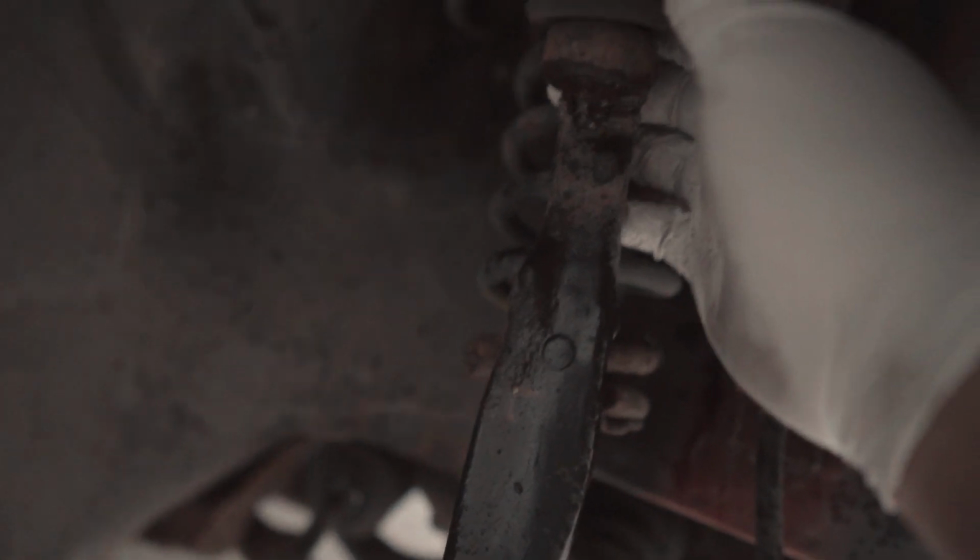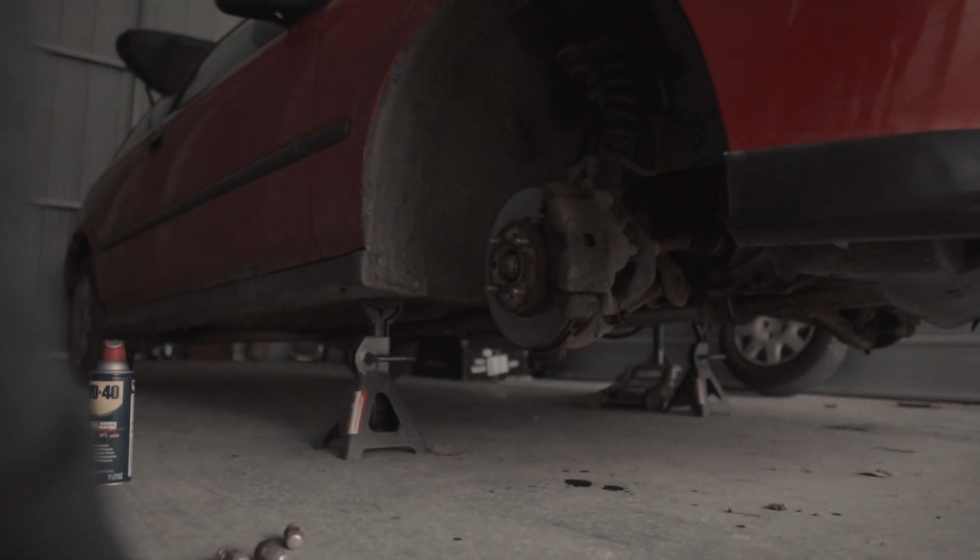All right. Let me jack up the car and then take out the old struts and put the new ones in. Alright, so the car is now on jack stands. So pretty much, if you haven't done this before, all you're going to need to do is take off this 17 mil to the upper control arm, and then another 17 here with another 17 nut right there. And then once that's done, all you're going to have to do is pretty much take it all out. Pretty simple. Oh, and then also these two bolts on the top hat, and the same on the other side. So yep.